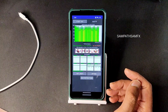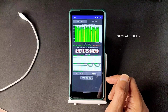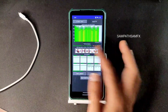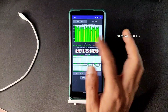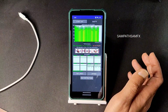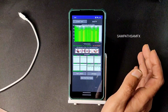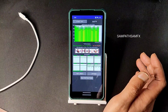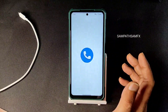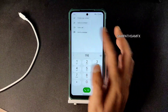I've been running the CPU throttling test for the last six minutes and seven seconds. The maximum is 147, average is 127, and minimum is 96. There is throttling going on — you can see a number of peaks visible in the CPU throttling app. Hence you can notice a little bit of throttling happening on this ROM.